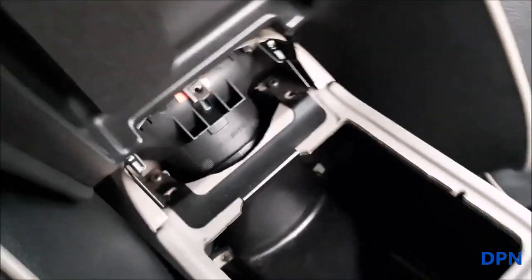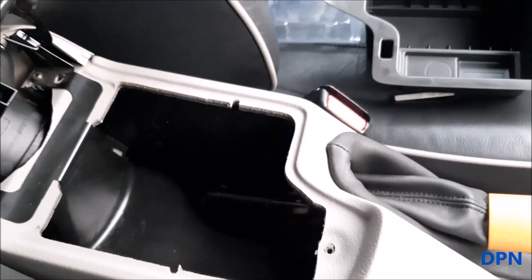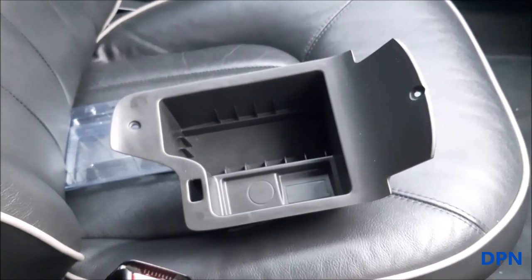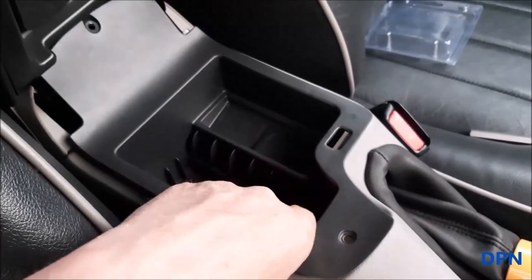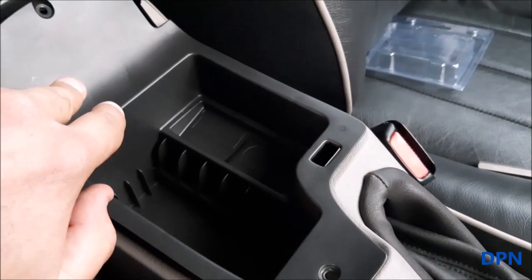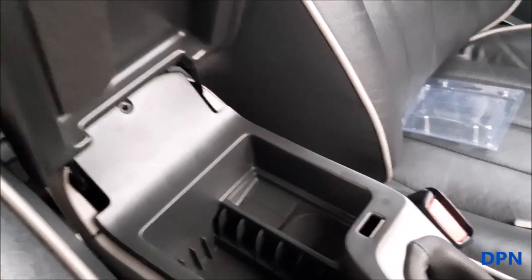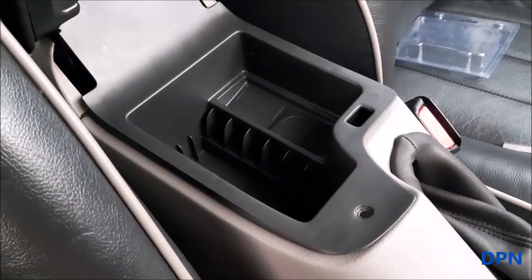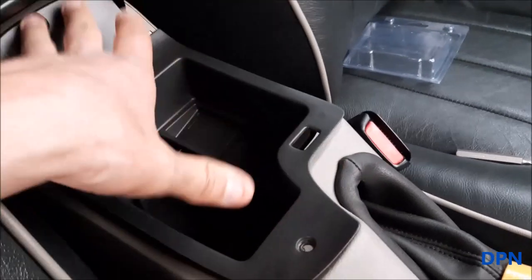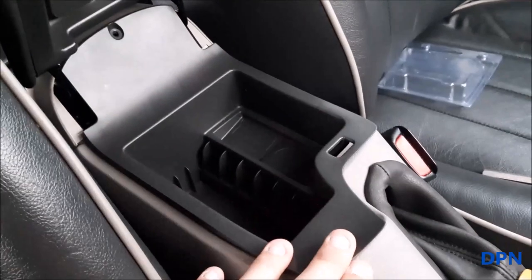All we need to do now is get the storage tray back in and fit the screws. What I had to do was push the tray up past the arm, which lets you get the bottom section in, then it drops back down. The armrest screws are actually behind the tray, so even if you removed the arm for better access you'd just screw it back and then drop the tray in. It goes back into place very easily once you've done it, though you need two hands to position it properly before putting the two screws back in.